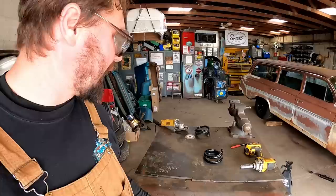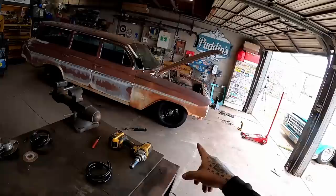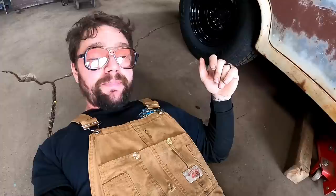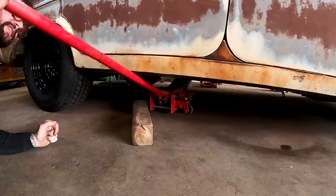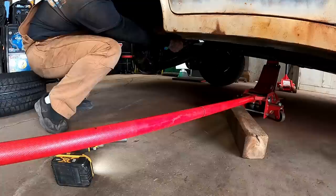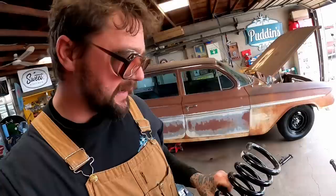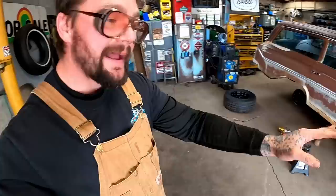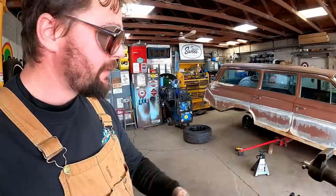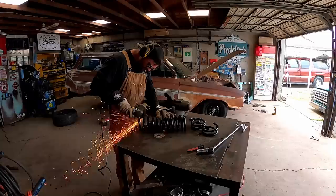I think that's perfect. I've just been sitting here staring at it, pumped. I sent it to Morski and he said that ain't enough to slam it. He thinks lifts are called hoists - they're obviously called lifts, that's why they're called two-post lift, four-post lift, not a hoist. We need to get the back lower as well. The rear springs sit on our control arms but I didn't put the shocks on yet, so if we jack the frame up high enough those things may fall out. I figured that'd pop out pretty easy. The back - I'm not sure how much I actually want to do. Kind of went for a home run on the front, here we'll go for a base hit - possibly cut it and if it ain't enough we'll do more.